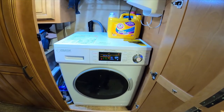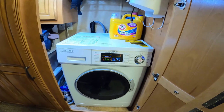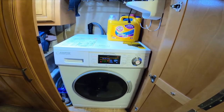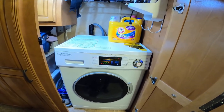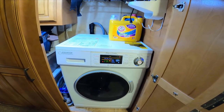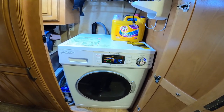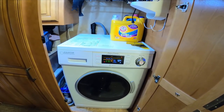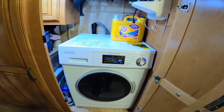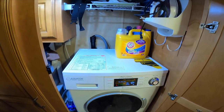A couple pairs of blue jeans, shirt, socks, and underwear - that's not a bad load and it does it pretty quick. I can usually take stuff out of the dryer cycle early when using ventless. If you have too much stuff in, wrinkle is a problem - in a smaller drum the clothes don't tumble and move as well as in a big drum. The lighter the load the less the wrinkles, or pull it out early and flatten or hang it. It seems to work well for a little apartment or RV - we're in a 36-foot mobile suite by DRV. Thanks for watching, I hope this was educational.